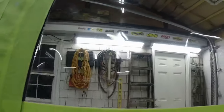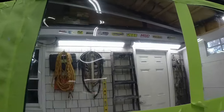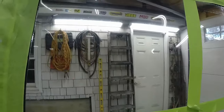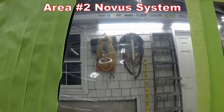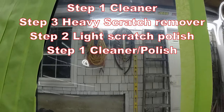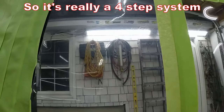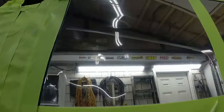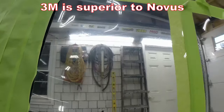I think this is probably the best out of all of them. I'm moving it around so you can see the scratches that are still left in the window. Now secondly, this is where I used the Novus system — it's a three-step system. You use a spray-on cleaner first, then number three as a heavy polish, then number two to remove those scratches, then back to one to clean it. You can still see a lot of heavy scratches in the Novus area. I don't think it's as good as the 3M area, so I'm still sticking with 3M being the best so far.